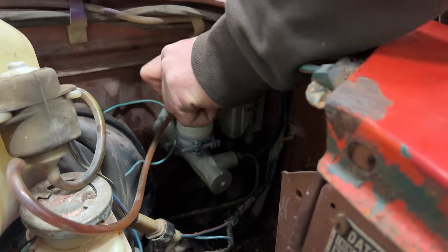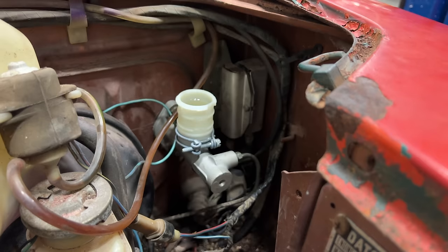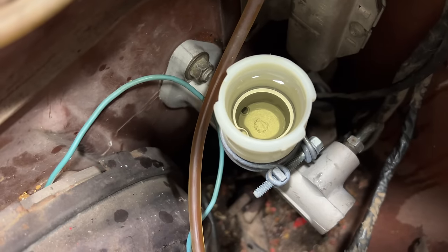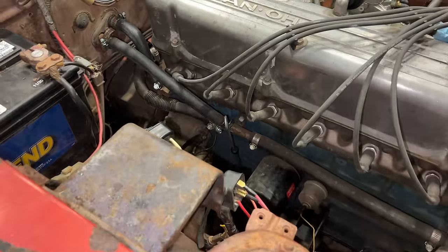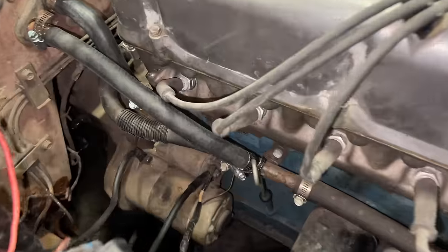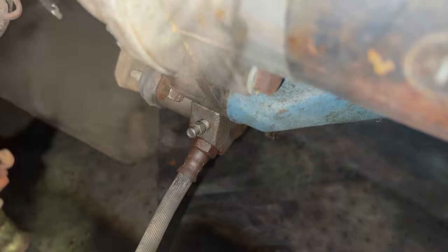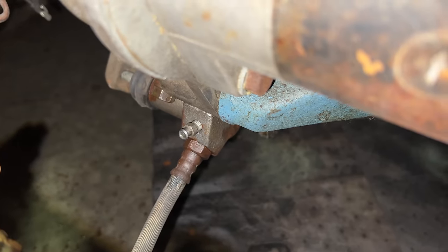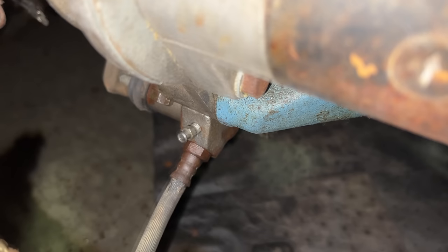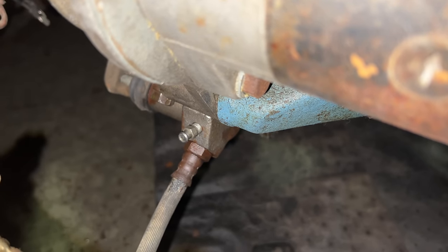Everything is reinstalled. Now I can put some brake fluid in. It's bubbling — some air is coming out already. I'll just let that sit and let the air come out before I start to bleed it. I've shown you how to bleed the clutch many times before, but on this car it's really nice because right under the starter is the bleeder valve and you can access it from the engine bay — you don't have to get the car up in the air. If you run a hose from that that goes straight up, you can bleed this very easily by yourself.